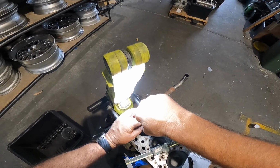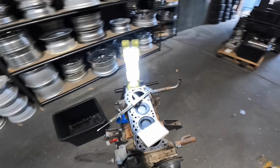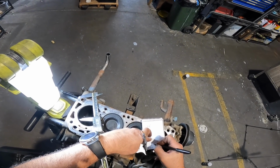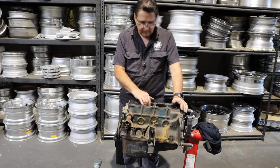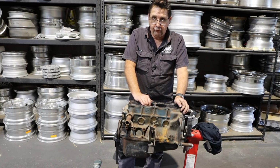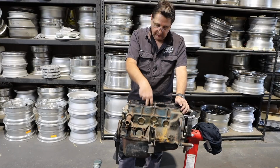Is there one that cops a bit more flak than the others on these? I don't know. Some of these very slight discrepancies could be my measurement too, the way I'm measuring it. As I said, it's the first time I've ever done this. Measuring the bores, they're within 0.04 of a millimetre, so four hundredths of a millimetre. Bottom, middle, top,